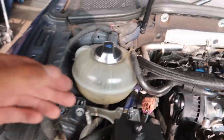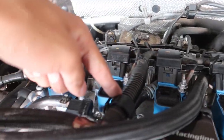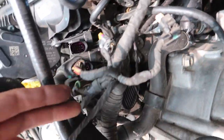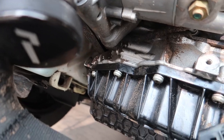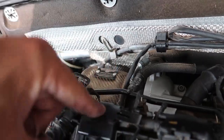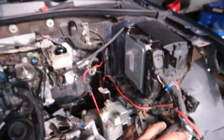Fuel rail pushed out of the way for now. Going around disconnecting just about everything — everything on the top portion of the motor comes across the middle and down into this harness, which meets up with all this stuff. There's another harness that goes towards the back, another that goes down to all these connections here. It also splits off further back and goes up here for the alternator. It's all pretty simple — just disconnect everything, open up the plastic loom to get the wires out, pull it through, and lay it on the side.